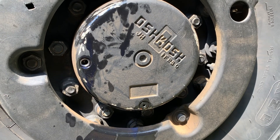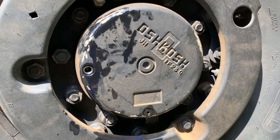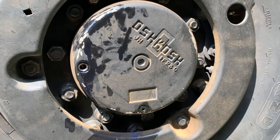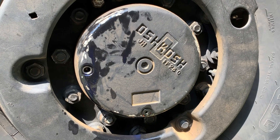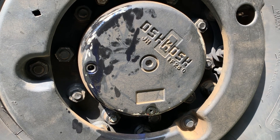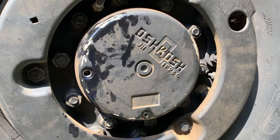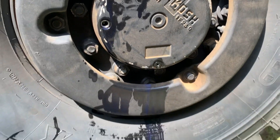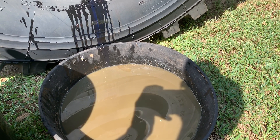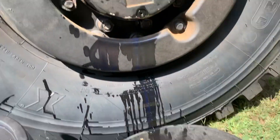I didn't realize this until probably 30-40 miles down the road — this left front hub on the truck was running warmer than the others by almost 40 degrees. Long story short, I topped it off and rolled on. The next morning I started doing some maintenance, changing the oil and checking hubs with a 2,000-mile-plus trip ahead of me, and found out that this hub was full of chocolate milk. Somebody had drowned the truck and apparently never serviced the hub afterwards or even checked it.